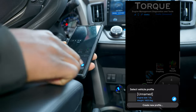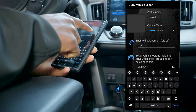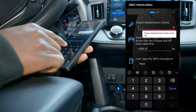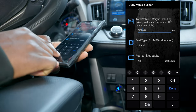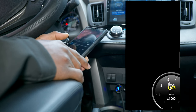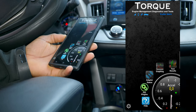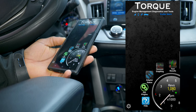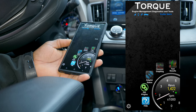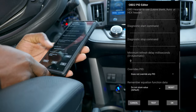Go to settings, vehicle profile, and change it. We're going to give this profile a name — let's name it RAV4. Vehicle type is SUV. Engine size is 2.5 liters. Total vehicle weight is 3,600 pounds if I'm not mistaken. Set the MPG and save it. Now let's press the accelerator and see — it is revving as you can see. Go to Manage Extra PIDs, select our transmission entry, select edit, scroll down, and click Test.